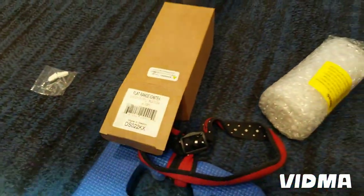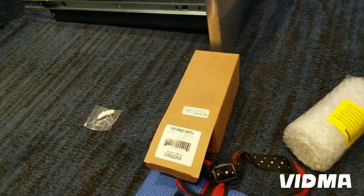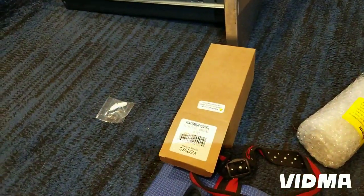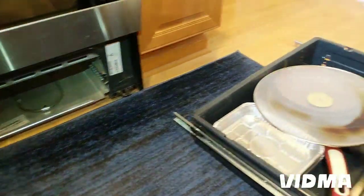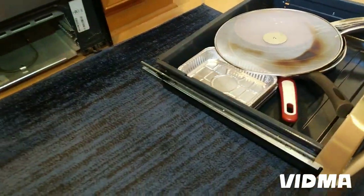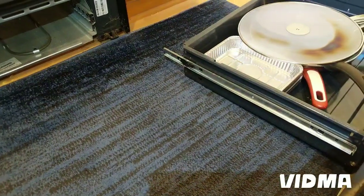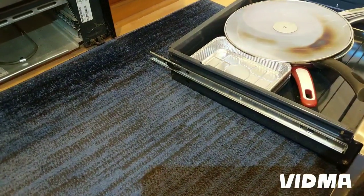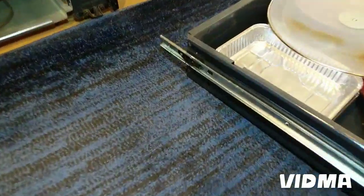And you can look that up online and check what amperage the igniter that you have is. The one that opens up. You want to make sure it's the right one, otherwise it will not open the gas valve or open up too soon. So it's not really a DIY project, but it's pretty easy to put a new igniter on, but you gotta make sure you get the right one, even though they look the same.